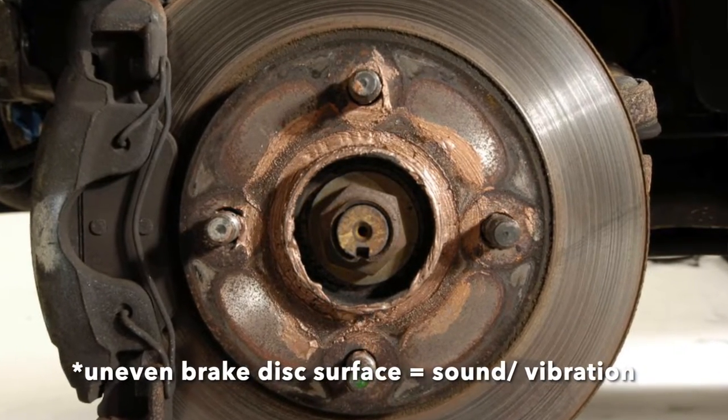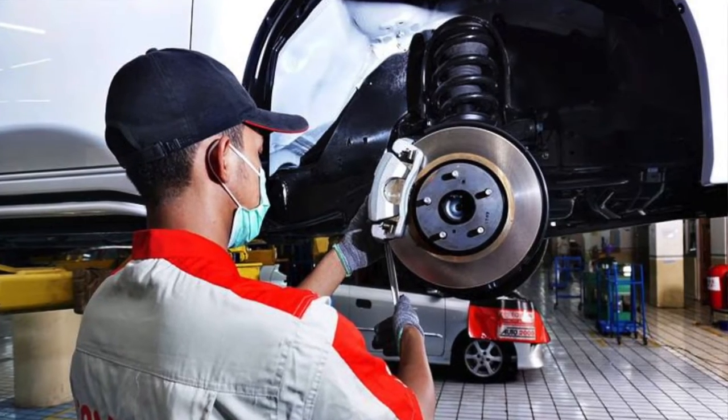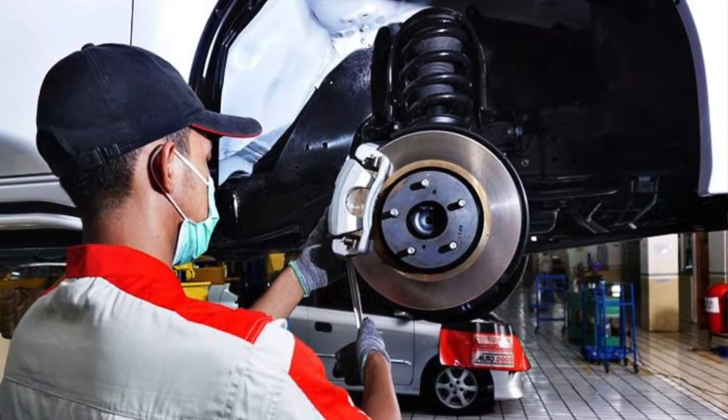The reason is that there is usually wear and tear on the brake disc, and when worn, you get undulations or uneven surfaces on the disc — this causes the noise or judder vibration when you brake. The workshop will then check the entire brake system to see what is wrong. If the brake pads are worn out, they recommend replacing the brake pads.